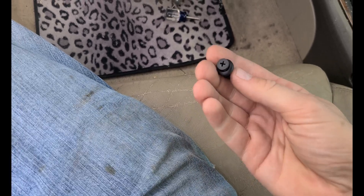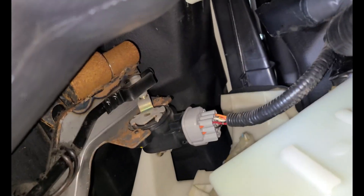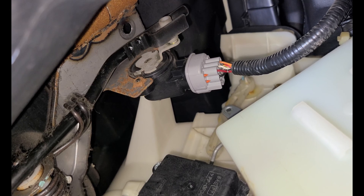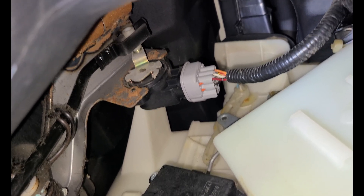You can buy a new one of these little nubs, or you can use something that fits in the hole — I'm going to try this right here. See that hole right there? That's our throttle stop. We're supposed to have something there to just keep the pedal in the right position, which is why some of our readings were a little bit lower than they should have been. Make sure you don't put something in there that's going to fall back out — otherwise it could actually stop your throttle from returning to rest and the car could keep accelerating when you let off the throttle. So be very careful, or just use a factory part if you're unsure.